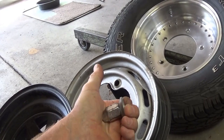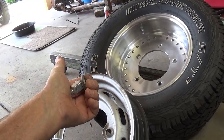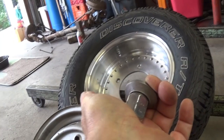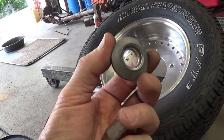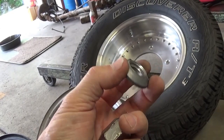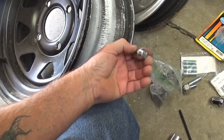They have thick aluminum wheels but they're not DOT street legal, and they don't have any type of taper — it's a little bit thinner, different type of aluminum trying to save weight. So you need this washer; you can see it's putting the contact pressure right where it needs to be. This washer is actually damaged because I loaned it to somebody else for their wheels and they didn't have the right lug nut and they tightened the hell out of it. It's just aluminum, so it deformed a little bit — these are just backups now because I have the horrible habit of not throwing stuff away.